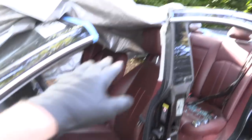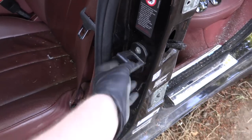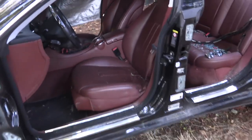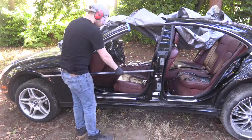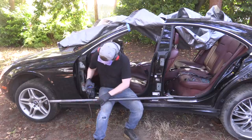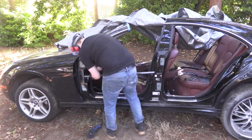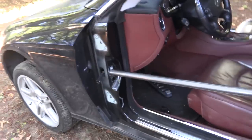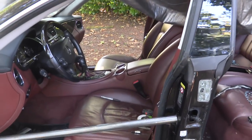I'm going to be working on the main door support bar. Since we lost some support in here we're going to add it back in right here - this is where the door starts and where the door ends. I'm going to build a plate that we're going to weld in here and a plate that we're going to weld in here, and then we're going to have a piece of very, very strong tubing running across there. So it's going to be like a door bar and a support for the car - it'll do double duty. Got the first bar cut up, it's a real snug fit, holding itself, and those are the two points we're going to weld it to. Eric said plates aren't necessary - the metal is totally thick enough, not worth wasting the time. Now I'm going to hop over to the other side and build another bar.